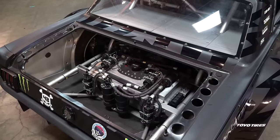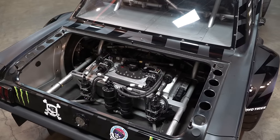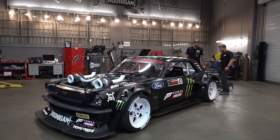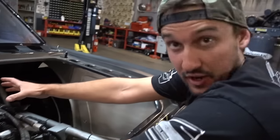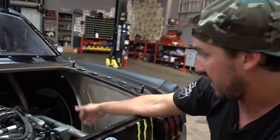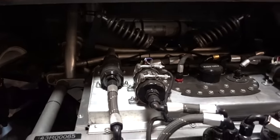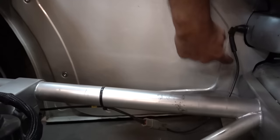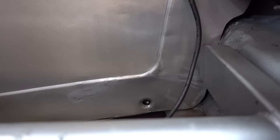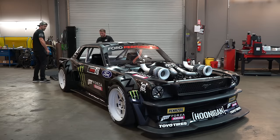It's a two-man job opening this up. Back here we have big lift pumps and surge tanks — very redundant for what we have going on, but this thing moves twice the fuel so we need that. This gives you a better idea of the push rod suspension — very similar to the front, with everything packaged inboard with the dampers. It allows for an upper and lower control arm. The trunk has some blemishes — it's not a show car, it gets worked over and over.